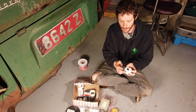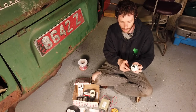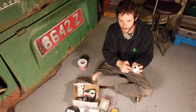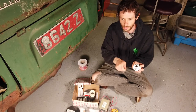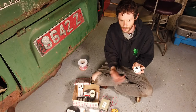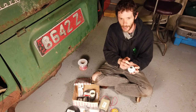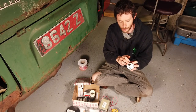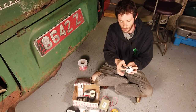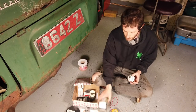I've already installed the sump plate sender, and that connects with a wire to the terminal on the gauge. Then we're going to draw some power from the van, and we need to make sure that's power that only comes on when the key is turned on. So we need to find a terminal on the fuse box that is alive when the key comes on, because we don't want our gauge running all the time and draining the battery. There's a ground as well, and the black terminal is where you plug in the lights for the gauge, which you'll want to wire into your light switch.